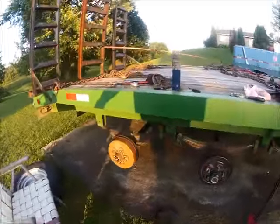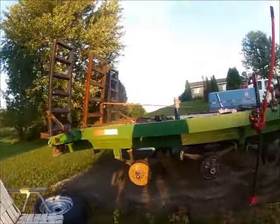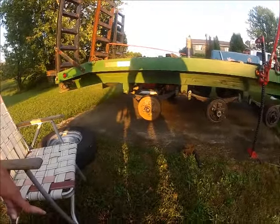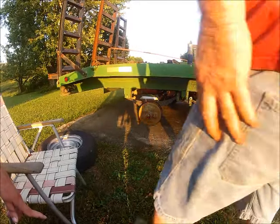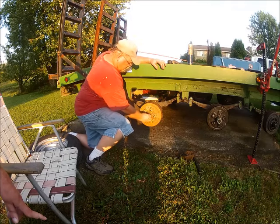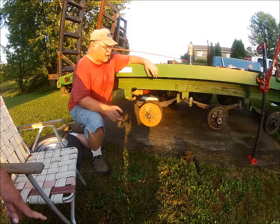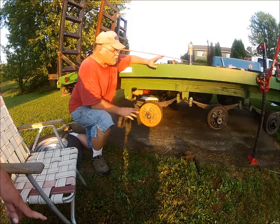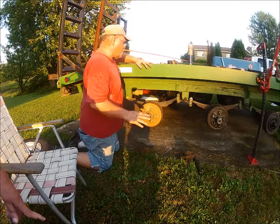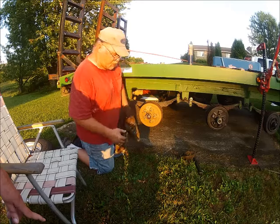I did the first two already, and I got this one apart. I'm going to set you up here with Kevin — he's going to be my camera holder. First thing I was checking for was the tightness of this nut. These were loose, just barely finger tight. They need to be tighter than that. There is a torque spec on those, but I don't know what that torque number is, so I'm just going to set them the old-fashioned way.